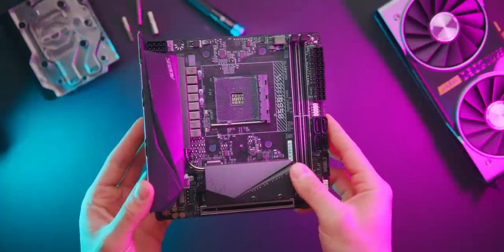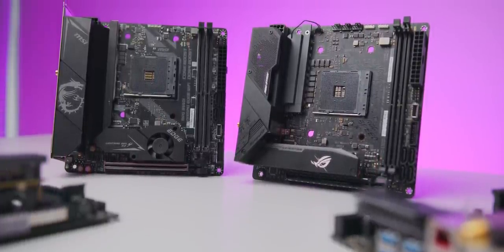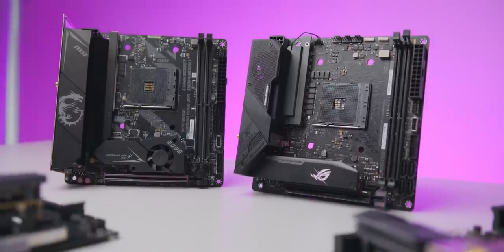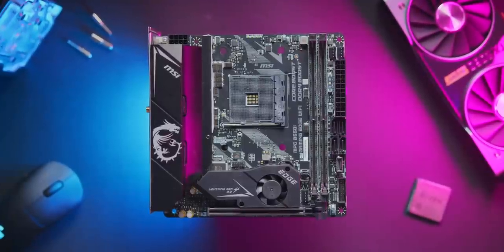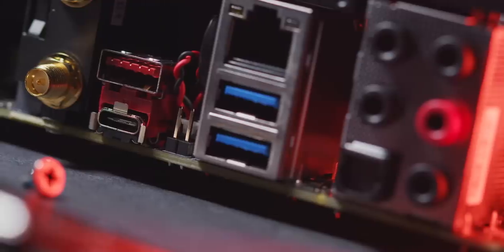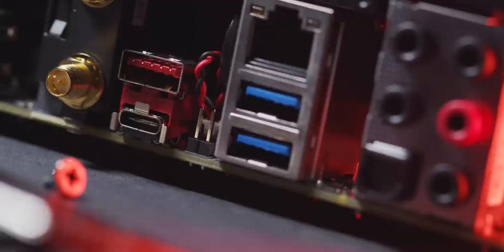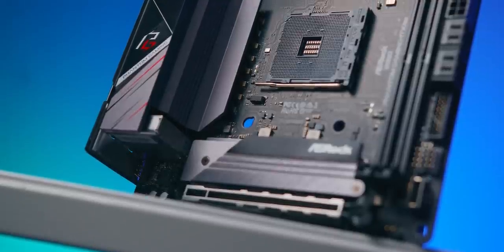If you do care about those two things, it comes down to the ASUS Strix and MSI Edge, both priced identically at around $230 USD. The MSI board lacks RGB backlighting and a 12V RGB header, which the ASUS Strix has. M.2 drive cooling should be a bit better on the MSI board, but if your overclock doesn't go to plan and your system doesn't post, you're going to be kicking yourself trying to access that hidden clear CMOS header. The ASRock B550i Phantom Gaming kind of has everything on the surface without any missing features or obvious problems, however it did run the 3950X at stock a bit more aggressively and quite a bit warmer than the other three boards.